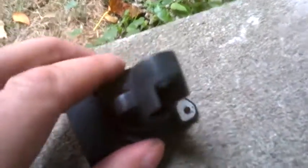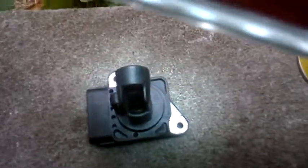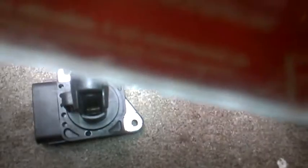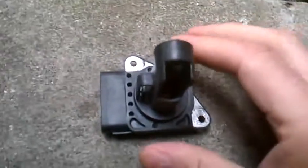The MAF sensor is buried down there below. You can see there are two small wires down below there — that's the MAF sensor. There may be another one. They are two very small wires. Never touch them, just spray on them, maybe from a distance. The wires look really small and fragile.